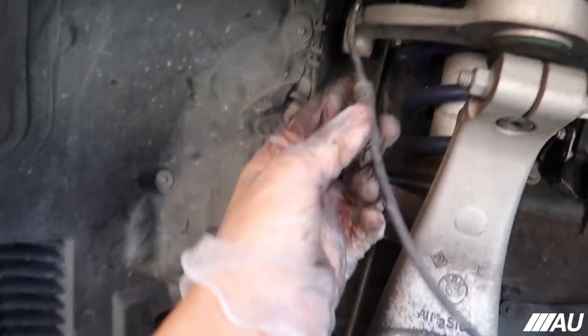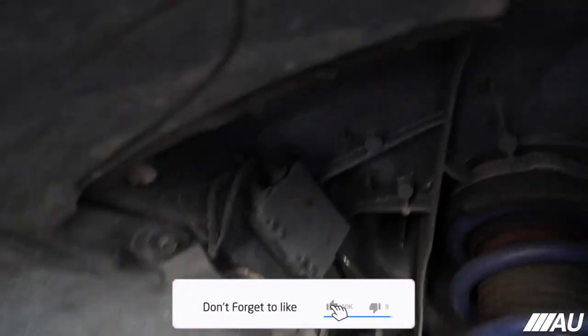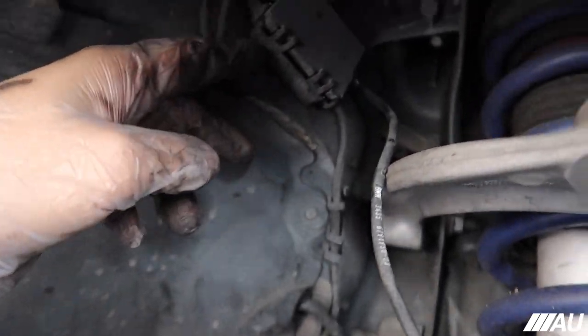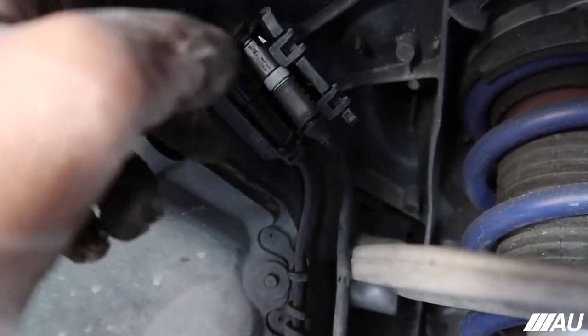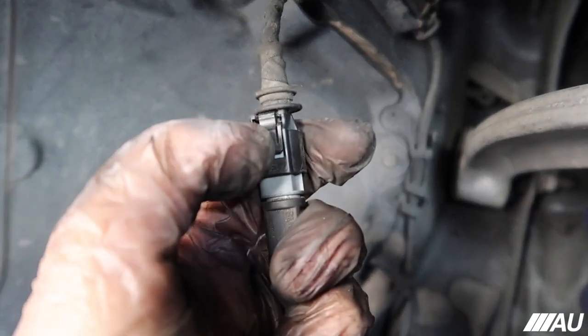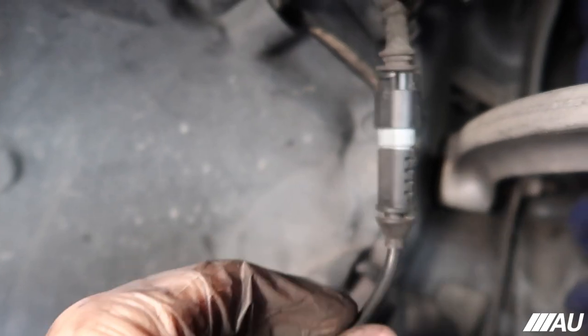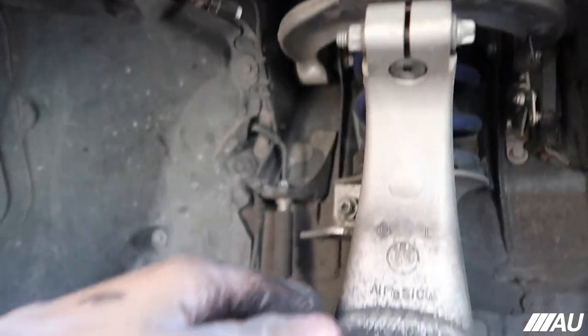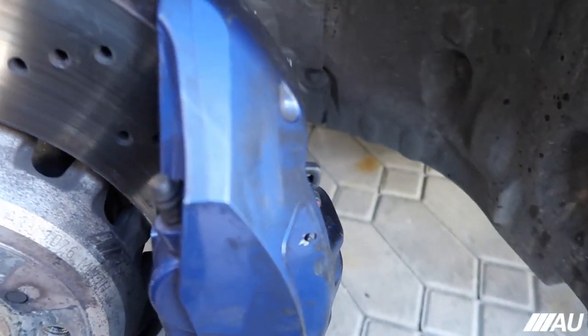All right, guys, so I took it off of all the spots that I told you guys about. Now if you go up here, I can probably take this off with my nail. There you go. Or you can use like a little flathead or a pick tool to open it. Open it up. And then you can probably pull it off from the bottom. Pull it off from the top. Okay, cool. Now, as you guys can see, there's a clip right here. Now, if you press down on this clip and then pull them apart, it should come apart. Let me try to do that real quick. Oh, perfect. So it came off super easy. Now I just gotta take this off. Grab the new sensor, which I don't have with me, but I'm gonna do the same exact thing, plug it in, and then route everything back around where it was, and then put it back onto the brake pad. I'll probably show you guys when I actually put it back on over here. But yeah, besides that, that's all you have to do.